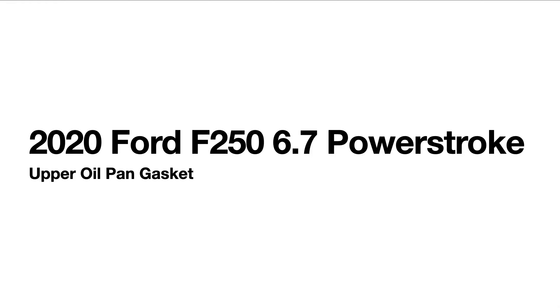In previous model years from 2011 through 2019 — I had a 2017 and a 2019 — in my 2017 I did have an upper oil pan leak, and you can go online to YouTube and Google on many of the forums. The upper oil pan tends to leak, or seep as some dealerships call it. It's pretty common, and I've done a video on my 2017 talking about how at the factory the machines spray the silicone, how they lay the RTV on the upper oil pan.